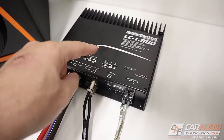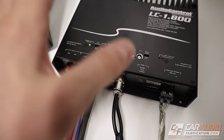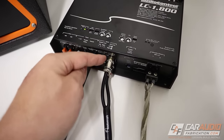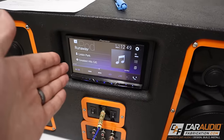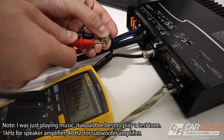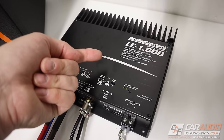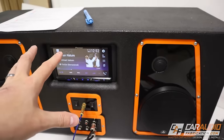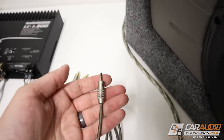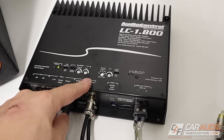What if all those things check out and the amplifier is turning on but we're still not getting sound? Earlier we talked about measuring signal at the speaker-level inputs, but we can also verify signal on the RCA line-level outputs from an aftermarket head unit. Make sure music is playing, put the black probe on the outer shielding and the positive probe on the inner pin, and you should measure an AC voltage. If you don't measure a signal, a good test is to use a 3.5mm to RCA adapter — plug it into your phone and send signal straight into the amplifier to help determine whether the head unit is the problem.